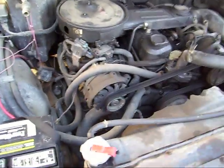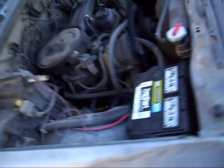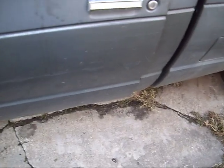The biggest thing is if you take off all the front stuff and the radiator, you'll have tons of room to work and to pull that engine forward and out. Now if you're going to pull the transmission too, pretty much all you have to do is unhook the lines to it — I'm assuming it's an automatic like a TH350 or something. Just unhook your lines and take your crossmember out. The crossmember is about the middle of your vehicle — a bar that goes all the way across from frame to frame, with one bolt in the center the transmission is bolted to, and two bolts on each side holding it to the frame.